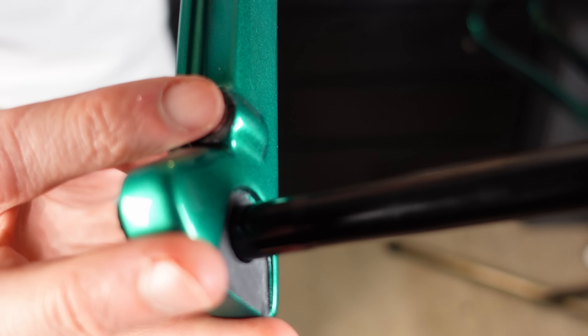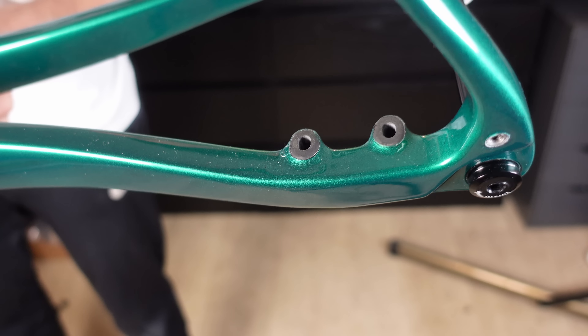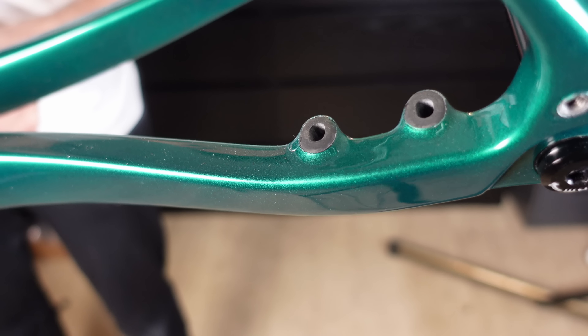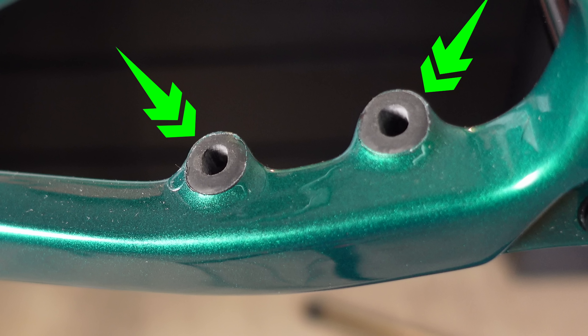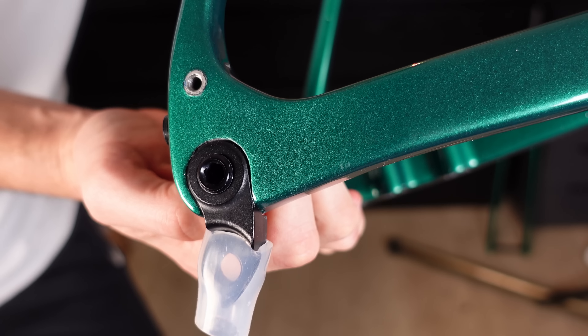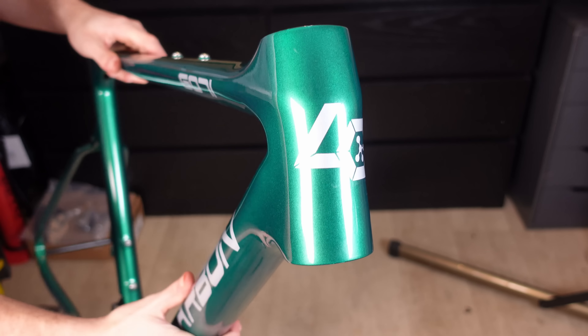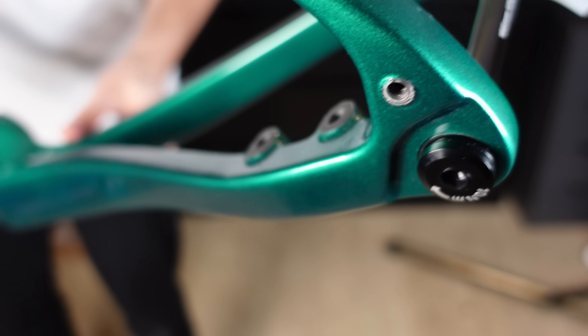What's nice to see straight away is the front and rear brake caliper mounts have been faced. This is a good sign. By faced, I mean there is no paint on the caliper mounts — the flat surface that will become best friends with the caliper. Around the rear derailleur hanger also looks very neat indeed. This is another area that can sometimes get overlooked or have excess paint, causing the derailleur hanger to be excessively tight. Just looking over this frame and I'm pleasantly surprised with what I'm seeing.